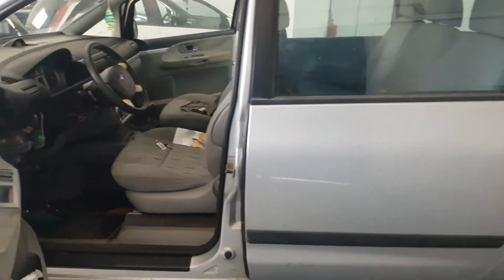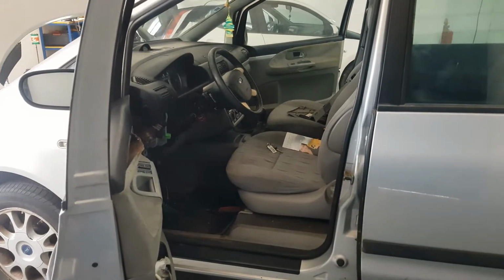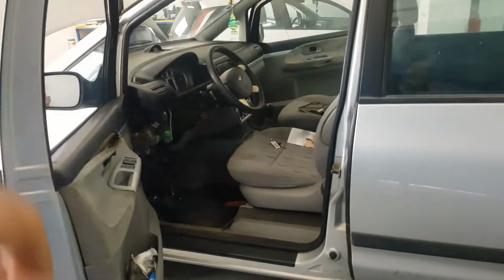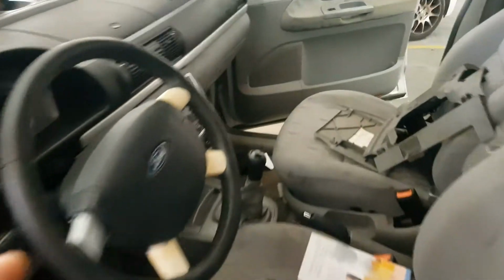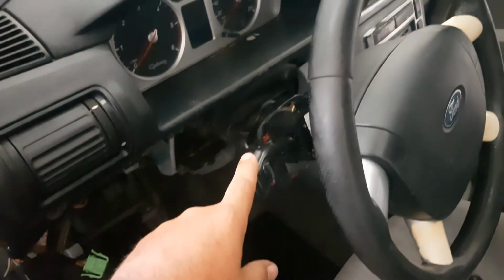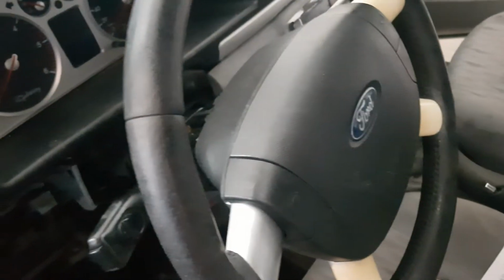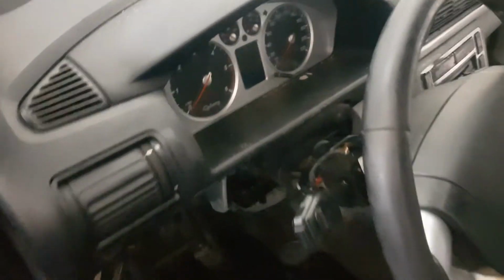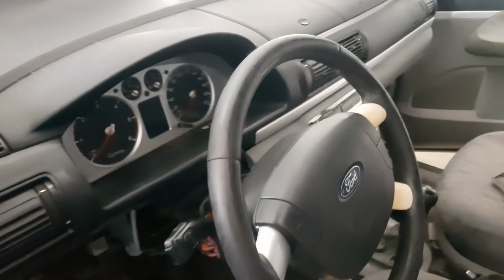I got this from another shop. It had a no blinking condition, no turning signals. So they've changed everything, from the hazard light button there, they changed the lever here. Still nothing. You would get the sound of blinking, but there was no indication here in the dash or outside, and no lights on, even though you had the ticking sound.